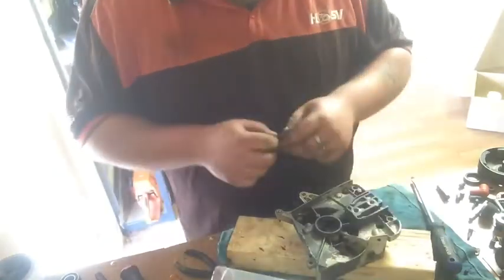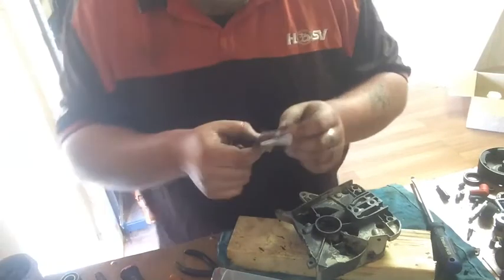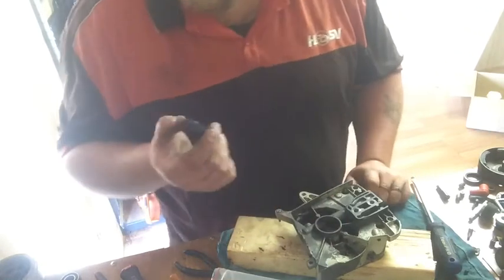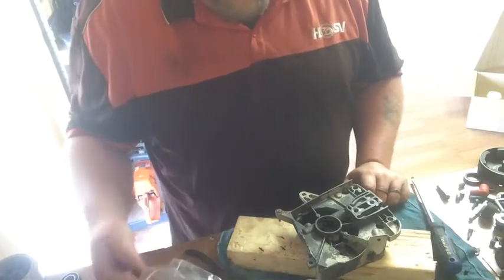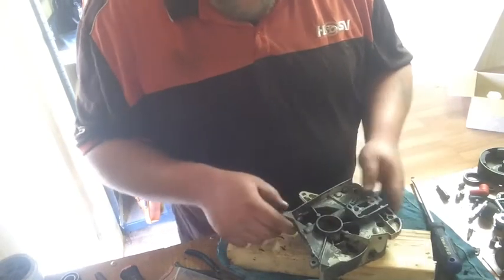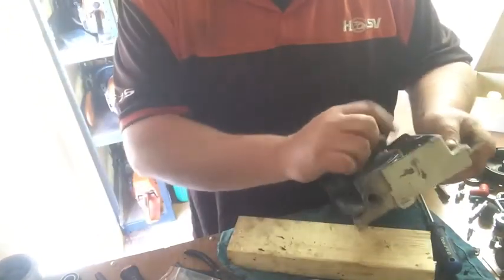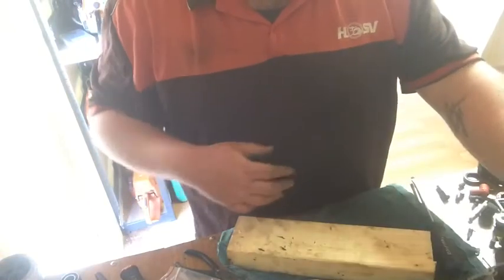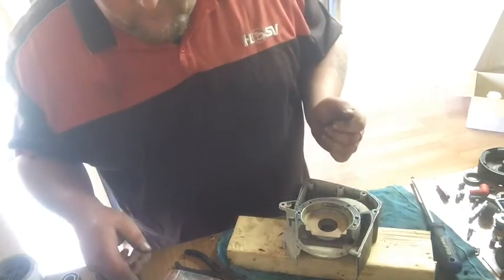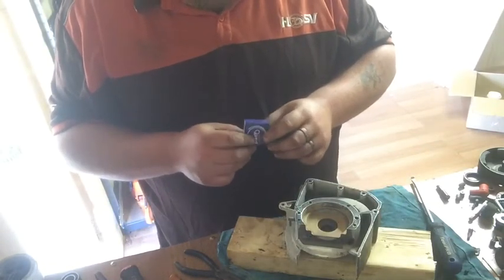So we've got flywheel side, clutch side, 400862N, and I believe this one you don't need to put glue on. These are the actual size, so we'll leave that seal until very last. I don't think the oil pump will work. Well, actually it's missing that part, so yeah, bearings in on the clutch side. Flywheel side is a 6002 standard, apparently.